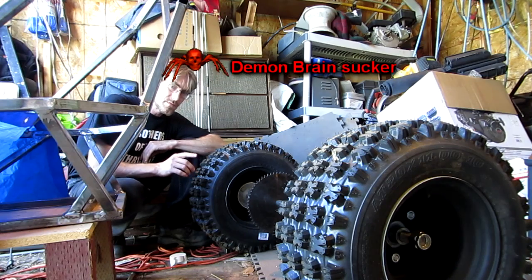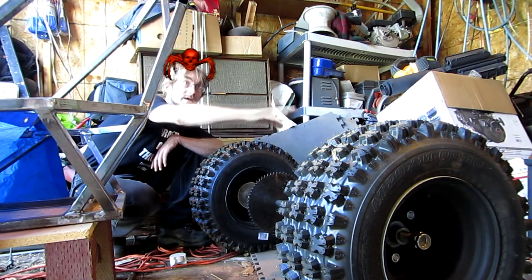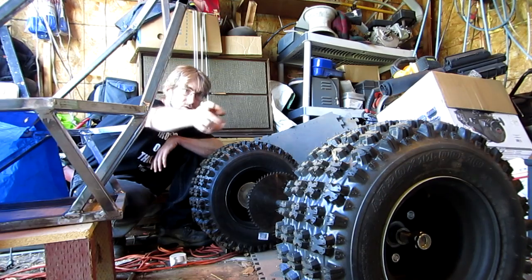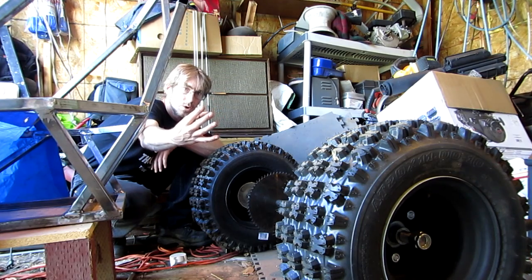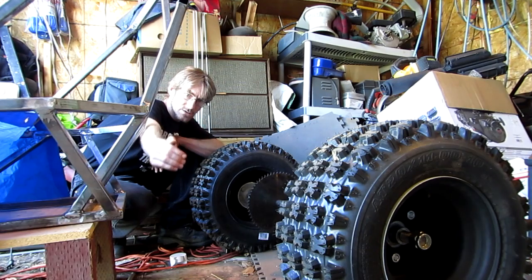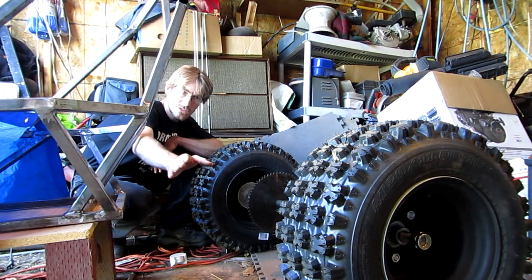I don't want to have to deal with that. So what I'm thinking about doing is I want to build off a platform off the back where the engine is going to go right here. The torque converter is going to be towards you guys and come forward. I'm going to need a jack shaft setup right here somewhere, and I'm going to need another sprocket going down to another jack shaft, which is where the pivot for the swing arm is going to be.